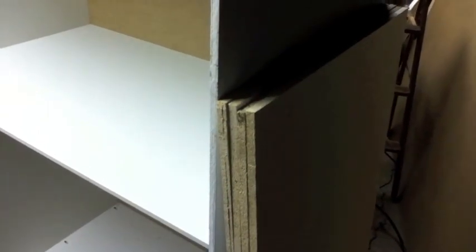The other thing I did — I had my wife pick up some melamine-lined board yesterday, which is the white double-sided stuff. This is the half-inch material. These sheets actually come in 49 by 97 inches as opposed to the traditional 48 by 96 four-by-eight sheet. That's kind of nice because edges get banged up in shipping, so they give you the extra one-inch overage so you can cut a clean sharp edge.